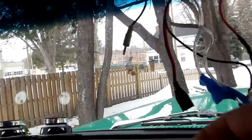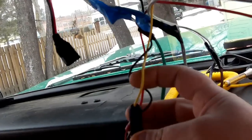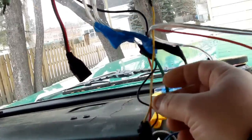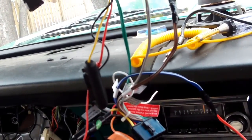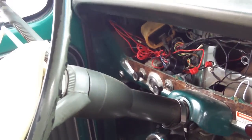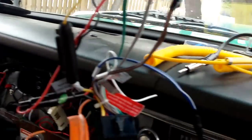I have my CB power — when I first did this I got a little lazy and frustrated and just wanted to get it done. I took the power from the radio, the one that goes to the battery, and spliced that in with the power for the CB — the always-hot wire. What ended up happening was if I turned the volume up too loud on the stereo it would blow the fuse for the CB. The fuse for the CB is down under my dash, so it wasn't a huge problem, but I really couldn't turn the stereo up too loud.